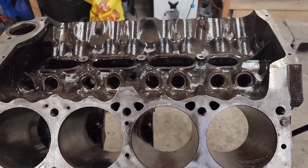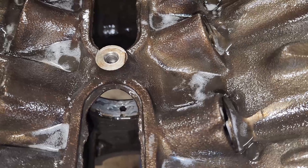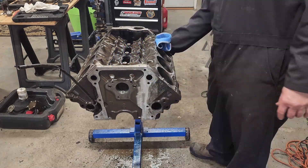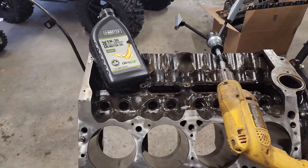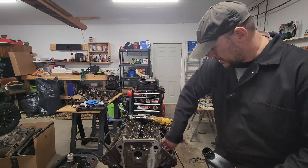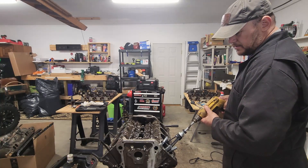I don't actually feel anything - it feels nice and smooth, but I do want to get that taken care of. So cylinder honing - that is one of the two things that we need to do. The other thing is we need to replace these cam bearings, because if you stuck around to the end of the last video, you would have seen that chewed up cam bearing, and I'm pretty sure I did that when I pulled the cam out. We can't do the cam bearings today because the tool won't be here until tomorrow, but we can get the hone done. Start by wiping out any excess dirt - we don't want any large chunks in there to catch on the stones and gouge the wall. I've got a three stone hone and a little bit of motor oil. I'll put some oil in the cylinder, wipe it around, and get oil on the stones too. You don't actually want to pull it up too far, otherwise your hone will fly apart.